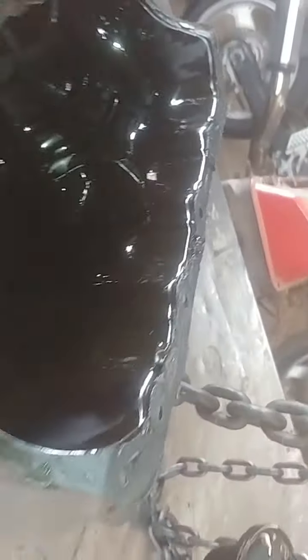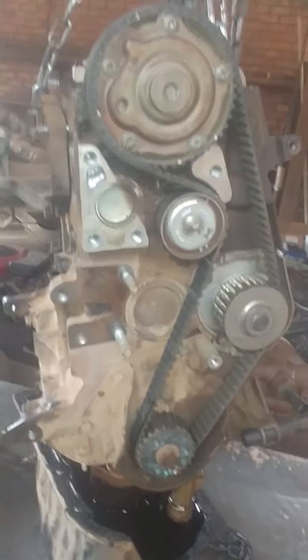Hope this helps — just wanted to give you guys a quick rundown on that. We're going to be tearing this thing down to see what the damage is on the inside. You can see a lot of metal flakes there at the bottom — all that metal right there. The damage occurred because the car was driving, hit something in the road which knocked the oil filter out completely on the side, everything ran out, and now she's done. That's the long and short of it — good luck with your bolts.